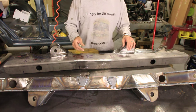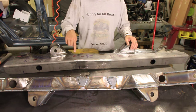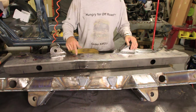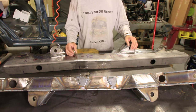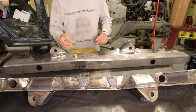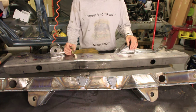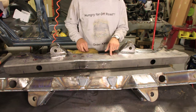What I was doing there, while it was underneath there where it's supposed to be, I drilled some holes and the reason I did that under there was so that I could match those holes to the actual frame under there. So now I need to drill those out to a larger size, and then I'm going to weld these on the back. That way I'll be able to use these bolts — I've got some big heavy-duty bolts here — and that will hold my crossmember on. That's the plan anyway, so let's get over and start drilling these holes out larger.